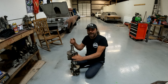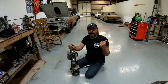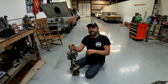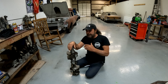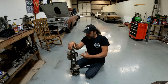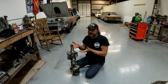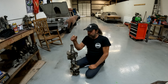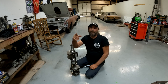With that, we know this thing is good to go. We'll cut it 10-10 and drop it off at the machine shop tomorrow. The lesson here is you've got to use all your senses. You inspect visually — anything unusual, you really scrutinize. You use your sense of touch — you can feel the imperfections. You use your hearing, especially on something like a crankshaft — that ring tells you a lot. And you have to use deductive reasoning, throw some detective work in there to really determine the story. It's a bad chrome job. Who would have thought?